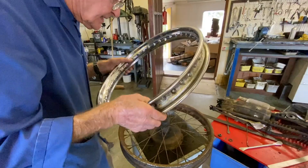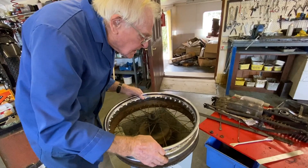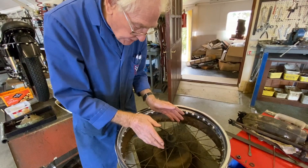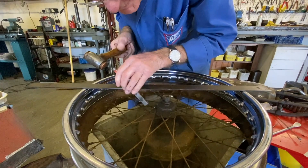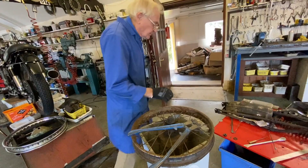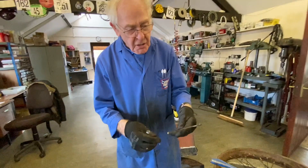If you place that on there like that — get the valve hole there — I'm going to put a mark on here so when you come to rebuild the wheel you can put the valve hole there and you should have a good start on the position of the spoke angle. So we'll put a mark there. That's the rear rim — we managed to have one in stock; the front one we'll have to order in. When I'm ordering spokes, I just send those sample spokes to Central Wheel — that's what I want. I don't give them any dimensions because there's lots to think about: there are nine different angle heads, that's 90 degrees, spoke nipple can vary. So if you just send them two of the originals, they should get it right.